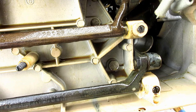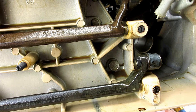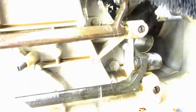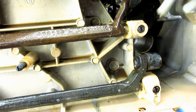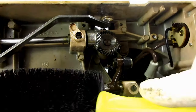Get a rag here. So that stuff now will come off. Okay. See? All right. And then before I finish on the bottom here, after spilling it, I'm going to take my 50% solution and dip my wheel brush in there, to just kind of do one last scrubbing up in that motor tube and up on the rocker shafts and lifters and into the little areas here.